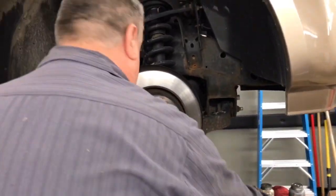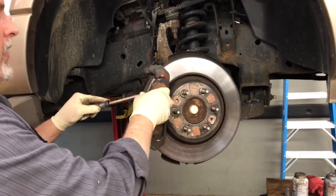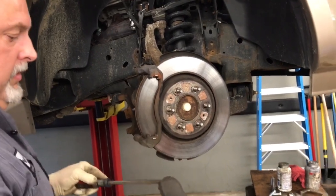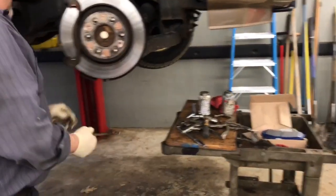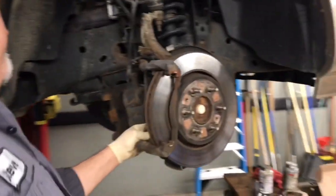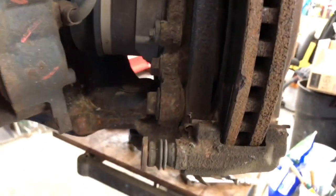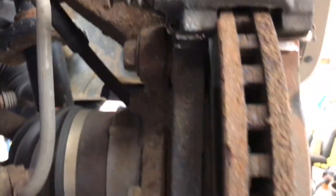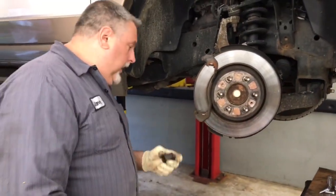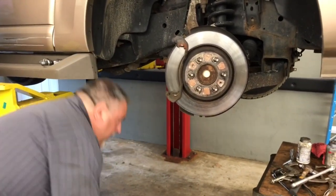This one's probably going to come out okay. That's the way the other one should have came out. Obviously the clip on the inside has been very dry for a while. So we're going to take the caliper bracket off — I think these are 18s or 19s. What we're referring to are these clips on the inside, one on the bottom and one at the top. We're going to take the 21-millimeter socket because we have an impact, and we'll let that do the work for us.